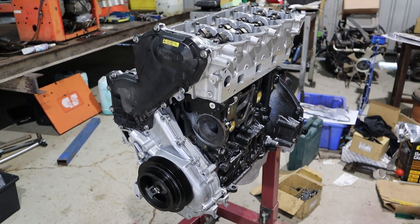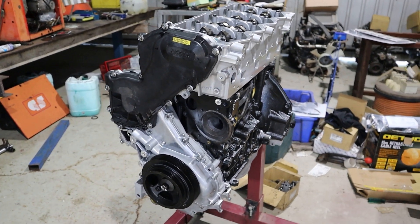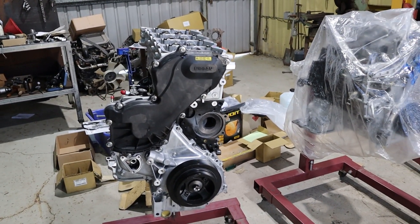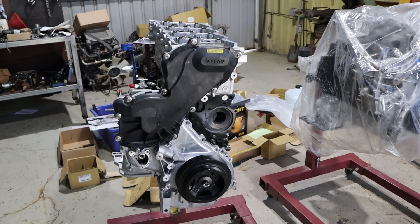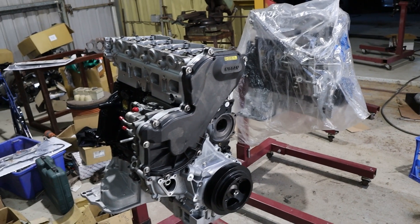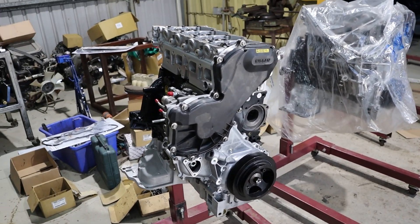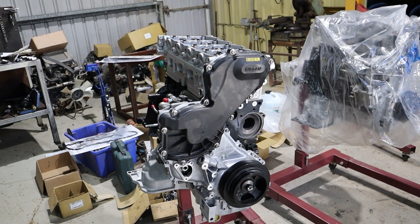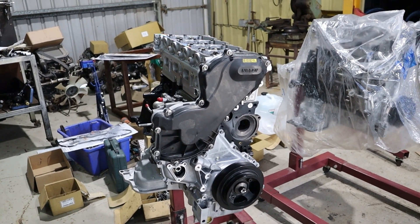That's the YD25 long engine assembled. If you want, turn the crank over two revolutions clockwise to make sure no pistons are hitting valves, especially if you're concerned about how you set up the chains. I'll leave a link to a workshop manual in the comments section — if you have any questions, just leave them in the comments below.